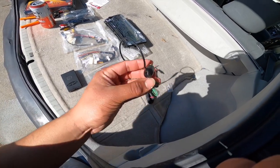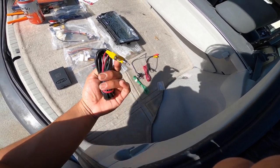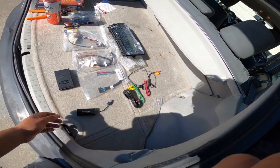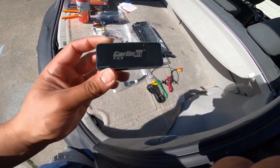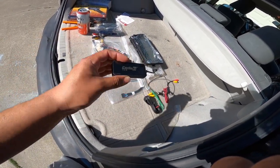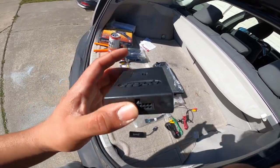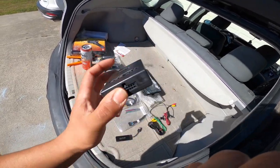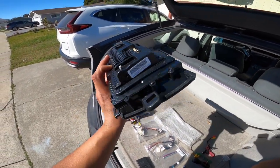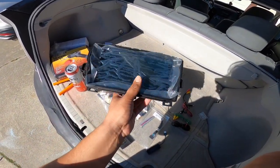I had to run and get this rearview camera that we're also going to be installing — it's off-brand. I'm connecting that with the RCA wiring and the power wire so it turns on whenever reverse is engaged. This is just a wiring extension. I got the CarPlay kit right here and I'll show you guys how to do it — you basically have to download an app on your head unit. This is the transmitter for the JBL sound system, comes with two harnesses, and then we got the head unit here — got it on Amazon, links in the description below.